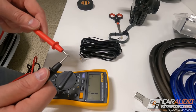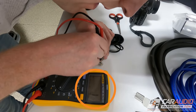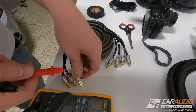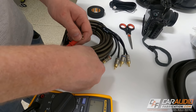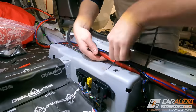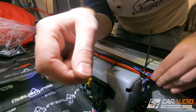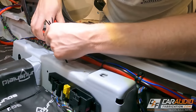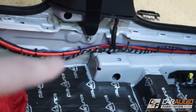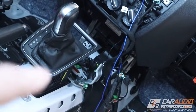Here's another helpful tip: before you run these kinds of wires that have smaller strands inside of them, always do a continuity test to verify that the wires are good. There's nothing worse than running a wire through the whole vehicle, putting all the interior back in, and then finding out there's an issue somewhere in the wire. I always do this for these dash control wires as well as RCA signal wires. As long as you use quality wire you will rarely have an issue, but it's worth doing this quick test for that one time you might find something. Now that I know the dash remote control wire is good, I can run it alongside the power wires and start buttoning everything up with zip ties. Always use a good set of flush trim cutters to cut that zip tie end perfectly flush with the head. And here we have it — the positive power wire is completely ran, everything zip tied in along with the remote turn-on lead and the remote dash control for the ACR 3 going in right about here in the center console.